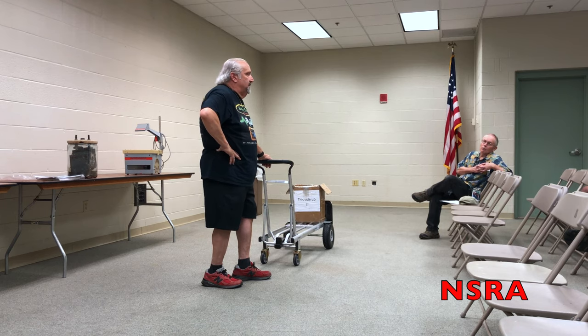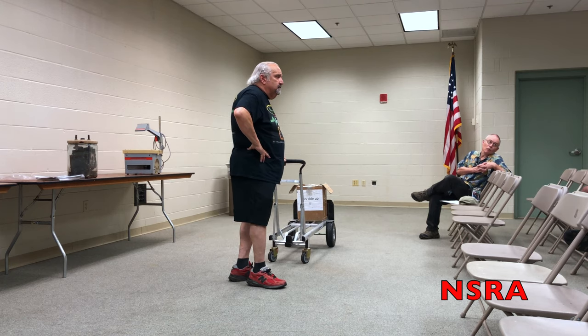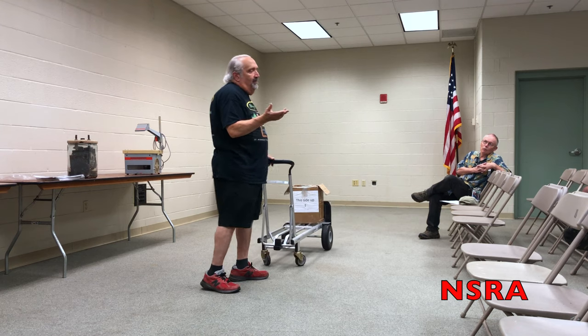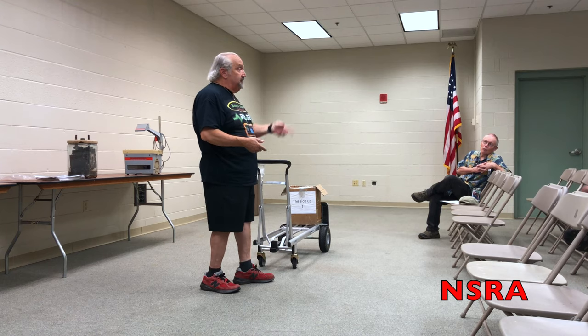If you've got cars, we've all been there, cold cranking amps is usually the thing. Let's back up a minute. If you've got standard lead acid versus maintenance free lead acid, what's the difference? You don't see the removal of the caps on them. Yeah, really, maintenance free means they're vented slightly differently. Most batteries today are called maintenance free, and there are still holes. Even if they put a label over the holes, those holes are still there.